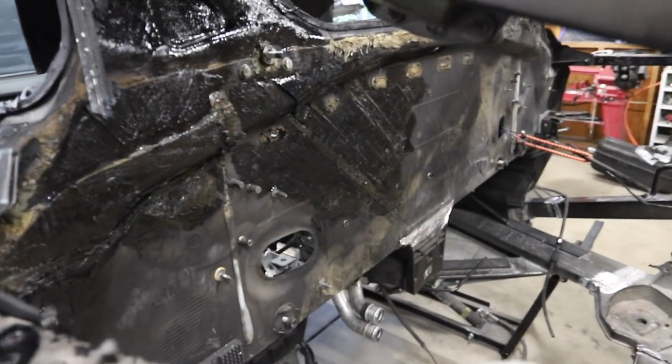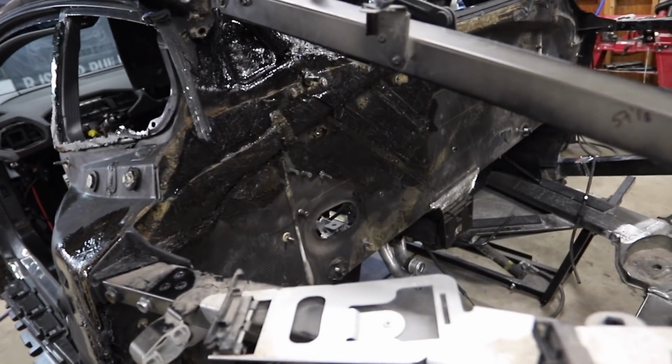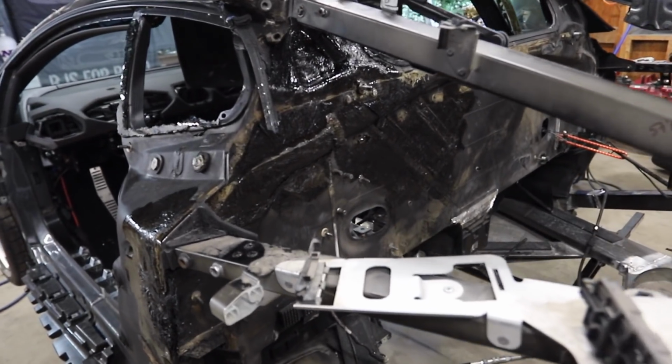Alright, that coat of resin really got everything back down to flat, and the game plan for that is I think once it dries, then I can come back and sand any of the roughness off, and then we're going to be recoating with carbon to make sure that we have a nice thick enough layer of carbon fiber there to do the job of the firewall.